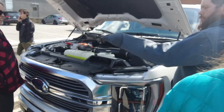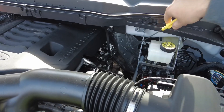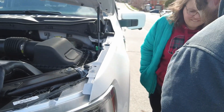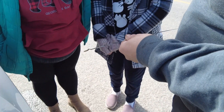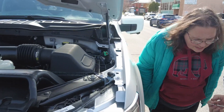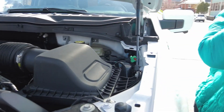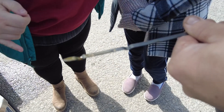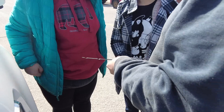It's a little bit buried down here on this one. When you pull it out, you'll have a low mark and a full mark — this one is right on the full mark, and it's a brand new truck so the oil will look nice and clean. Your vehicle will have two dots or two lines or a hash-marked section: as long as the oil is in that range, you're in a safe range. If it's below, you need to add some; it shouldn't be above that mark.